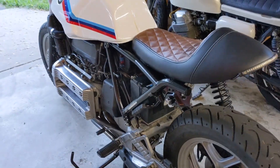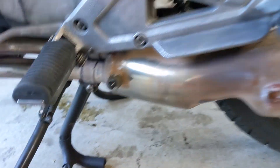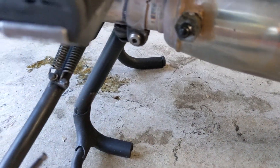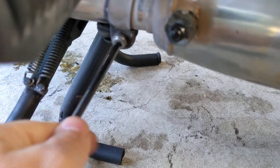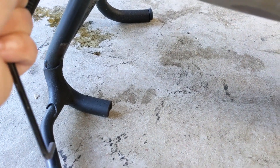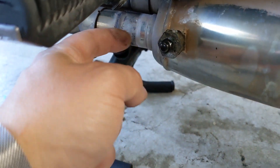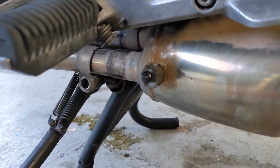With the heat shield off — four bolts — I wanted to show you the first of these clamps. It takes a five-millimeter allen wrench, and surprisingly I broke it loose fairly easily. I expected more of a fight to be honest. That one's moved out of the way and I'm hoping the other three go the same. I have a rubber mallet here and I'm hoping to tap this guy out.